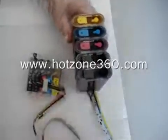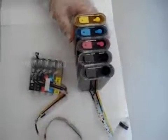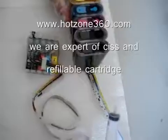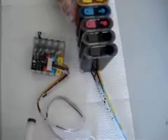This video shows how to prime the CISS cartridges. Actually, for most CISS, you really don't need to do that, even if they have a lot of air in the tube. But for some other printers, for example, Workforce 30 or C120, it will take many head cleanings for the printer to get all the air out of the tube.